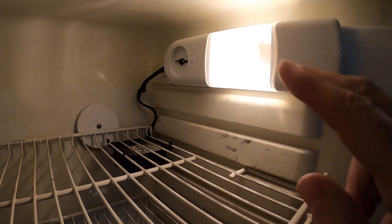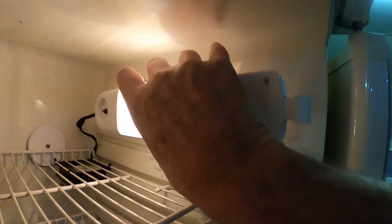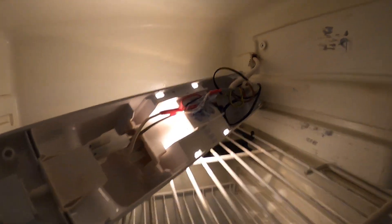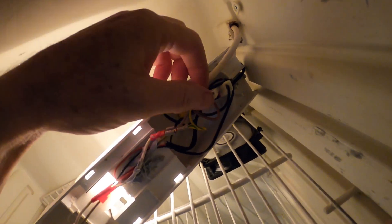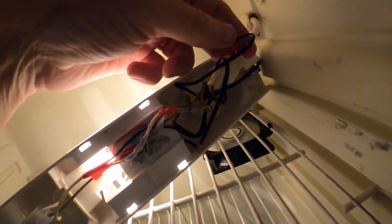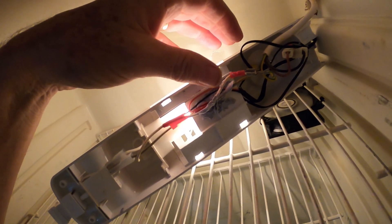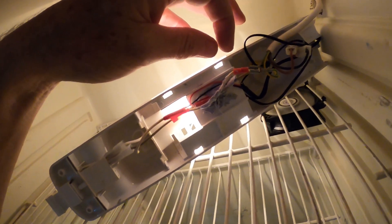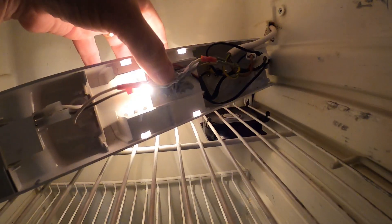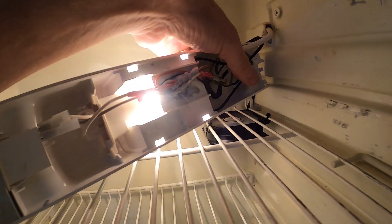I'll take this off and show you how it's all wired up. I've taken out the two screws and the module just slides forward to come off. You can see the wiring at the back — I used the existing wiring that came through from the fridge so I didn't have to run any new wires. The original two wires that went to the original thermostat are now connected to the temperature probe, the light is still connected, and the power for the light is what's running the little circulation fan. There's some Blu-Tack just to hold the wires in position while reassembling.